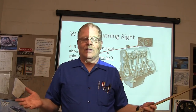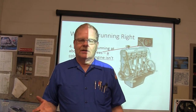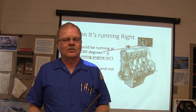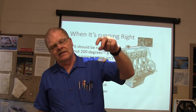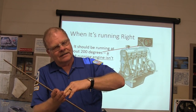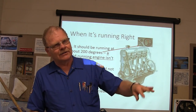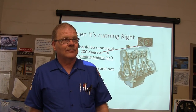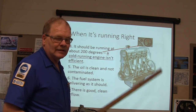One of the things we used to be told to do by the folks at Ford was whenever we had a rich condition causing it to go lean — what they'd tell us when troubleshooting — was to pull the PCV valve out and cap it off so there was no vacuum getting in, and see if the oxygen sensor normalized. If it did, you needed to change the oil. A lot of times you'd find somebody had gone too far without changing the oil and it wound up getting contaminated with fuel.